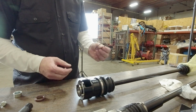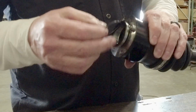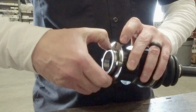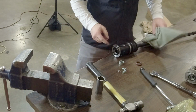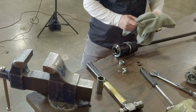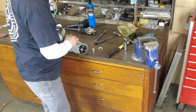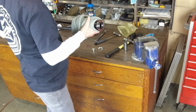Secondly, we will take our rubber O-ring, and we're going to put it right in this groove here. It's very simple. Without any lubrication or anything, you just walk it around and make sure that it's not twisted. This is where the vise comes in handy. It can also be used in this manner to put the hardened dowel pins in, but as I just demonstrated, it's not necessary exactly. It doesn't take a lot of force to get them in, but once they're in, they're definitely in there for good.